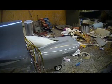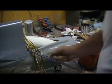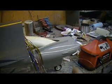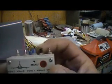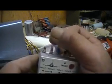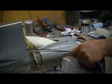There's no reason why you can't get these gear lines to not leak at all. I found the best way to do it is to separate them from the box. This is my landing gear box. I clipped them so I could see the colors, so it's real easy. I already replaced the orange one with that transparent purple one that I used for the gear. I like that transparent color. I just feel safer with it than the solid colors.